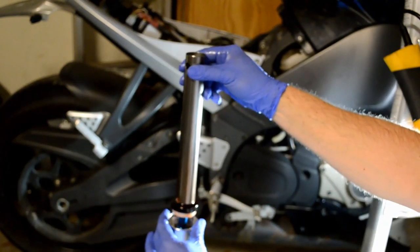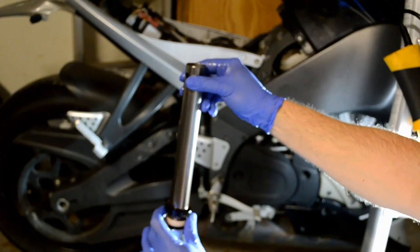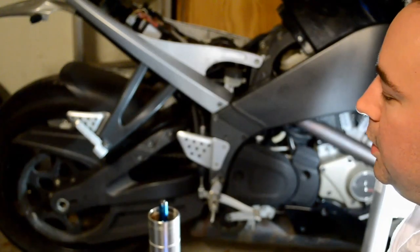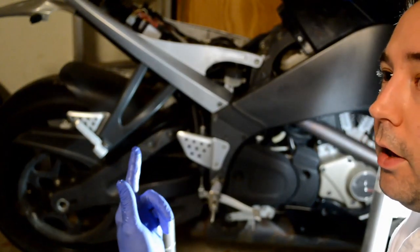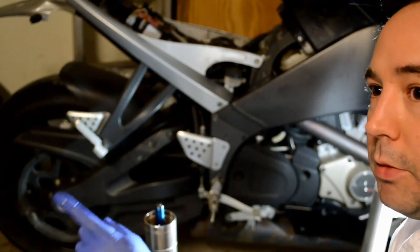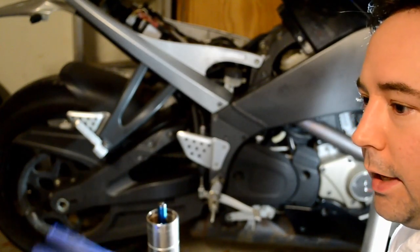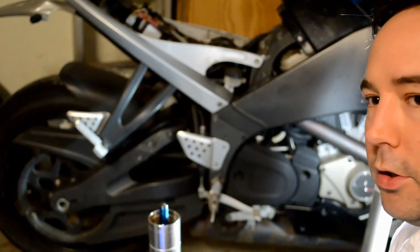Notice that there is oil coming off and a black sliding bit on the collar tube — I recommend keeping that where it's at. At this point you can dump your oil, but know that a spring is going to fall out. Make sure to note and mark with a zip tie which side goes on top, so that if it falls down and rolls around, you know which way it goes back into the tube.